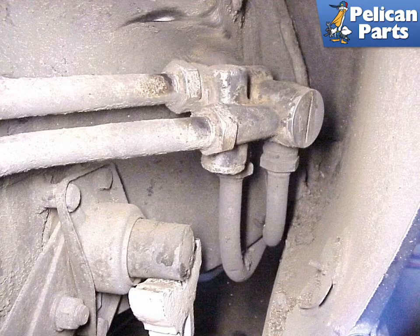Installation of the oil lines from the rear of the car is not too difficult if you have all the correct parts. Shown here are the lines and the thermostat, which is located in the right fender well in the rear, just in front of the rear wheel. The two lines that bend downward go to the rocker panel and run to the front-mounted oil cooler. The two lines that exit out of the thermostat go to the engine and the oil tank.